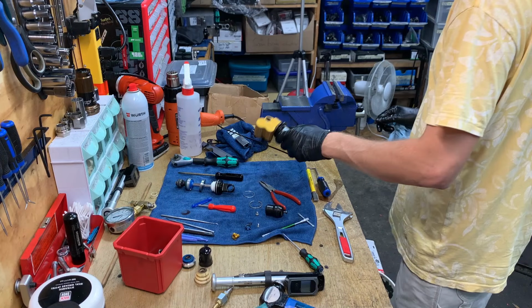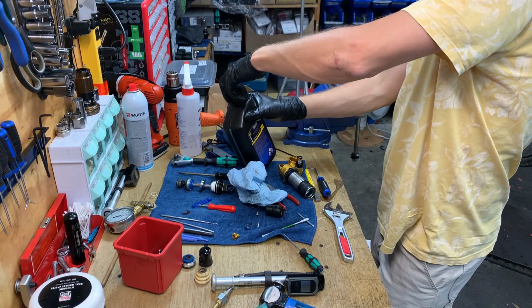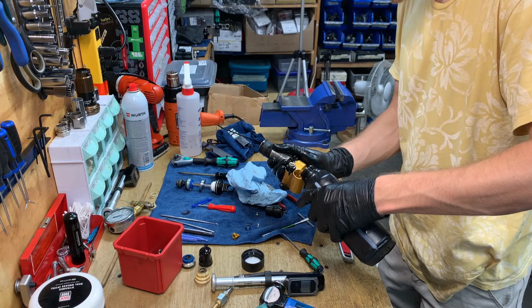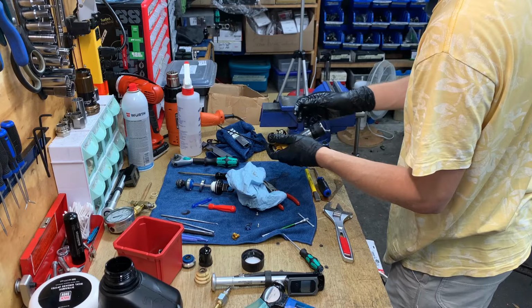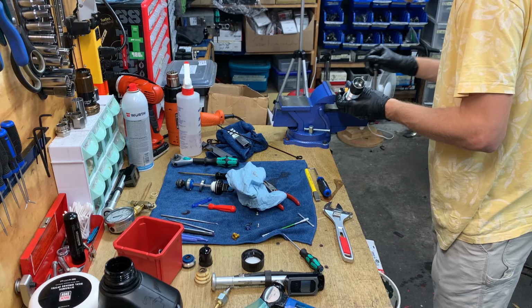Now, fillage. We're using Ohlins 2.5 weight suspension fluid. So, just like to pre-fill this a tiny bit for this bladder. It overflows, of course, which is good. Then we push the bladder in place. Very good.